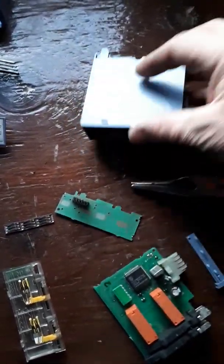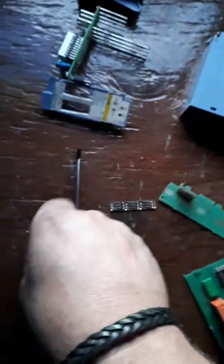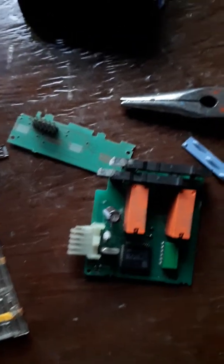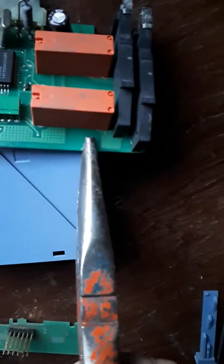When you pull this off, this piece is going to fall out and you'll be left with just the board stuck inside the casing. The board won't come free of the casing unless you push those two tabs at the very back — you can see where my finger is, that's the hole for the connector. On either side there are two tabs, and I managed to push them back with a regular flathead screwdriver going through the board side. After depressing both tabs, the board was still in the casing, so I took a pair of needle nose pliers, grabbed the board right there — nothing to damage on the back — gave it a yank and the board came right out.